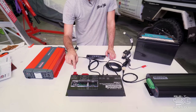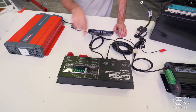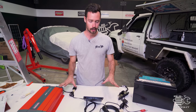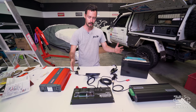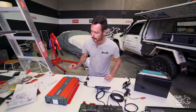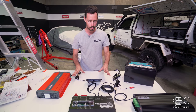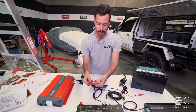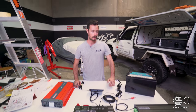The last thing is the ground to your battery, then a charger input which goes from your vehicle, and the auxiliary battery out which goes to the positive of your battery. Now that I know where everything is going and I've got everything hooked up where I want it, I'm going to install it onto that little frame, starting with this unit. I want to wire everything in with these little cable tie sticky connectors to tie all the cables down so nothing moves, and then once it all goes together and is fixed in, all these plugs can just come in and out. We'll go into the car, plug everything in, and the whole system is really easy to install.